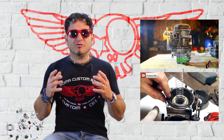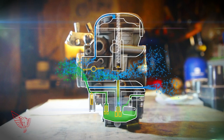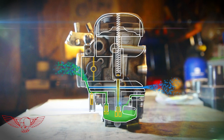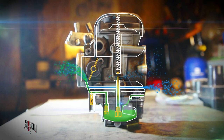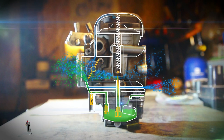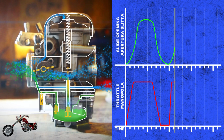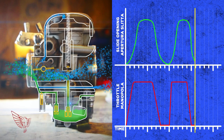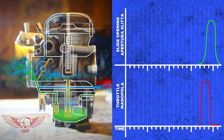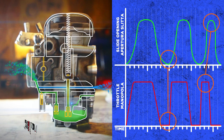I've already made two videos on how the stock CV carburetor works and how to rebuild it — the links are in the description — but let's do a quick recap. In the CV carburetor, and CV stands for Constant Velocity, the throttle cable is hooked up to a butterfly valve. As it opens, it transfers the vacuum created by the engine to a chamber on top of the carburetor that applies suction onto a membrane, which pulls up the slide and allows fuel and air to enter the combustion chambers. This system creates a smoothing effect between the throttle twisting action and the actual opening of the slide. Even if you twist the throttle very abruptly, the vacuum system smooths out any jerkiness in fuel delivery, providing the right amount proportionally to the low pressure generated by the engine itself.